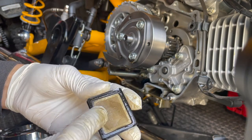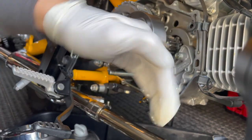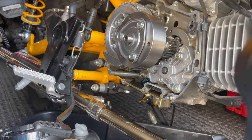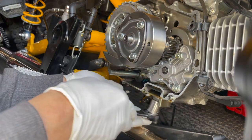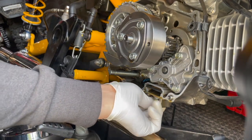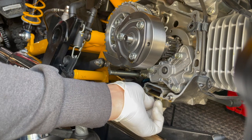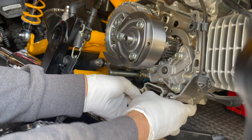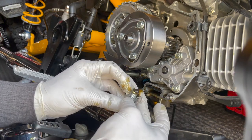I'm going to put the screen in that direction with the lip facing down. I knew about this but totally forgot to check it when I pulled it out. Now taking off the old plug — it's a 17 millimeter. The old plug is not as long as this new mag plug. The new plug is for BMW applications, but the thread pitch and diameter are the same.